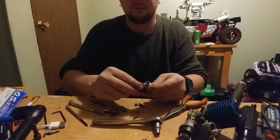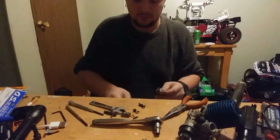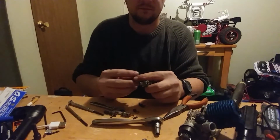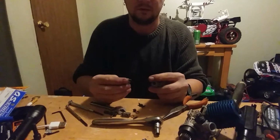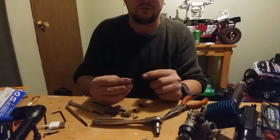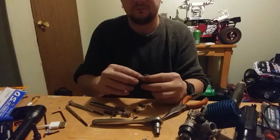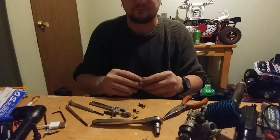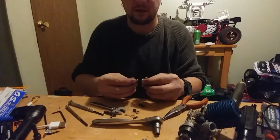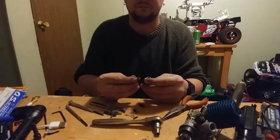That screw comes out. Out comes the rotary assembly, and out comes the low speed assembly. This can be set a little, but not very much, because you simply don't have many threads here. So just drop that back in. Put the rotary carb back in. You can see right there, you have a cylinder with a hole in it.